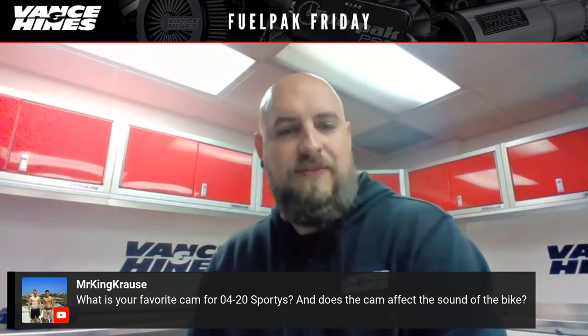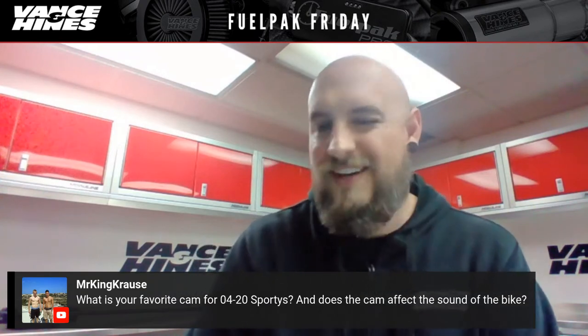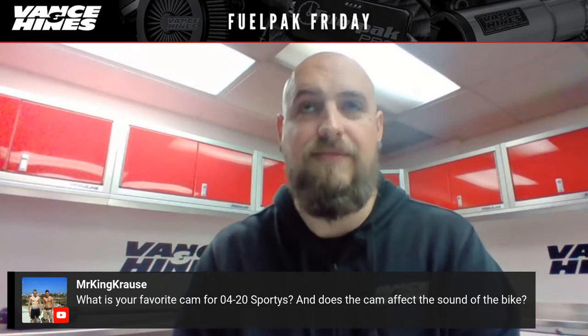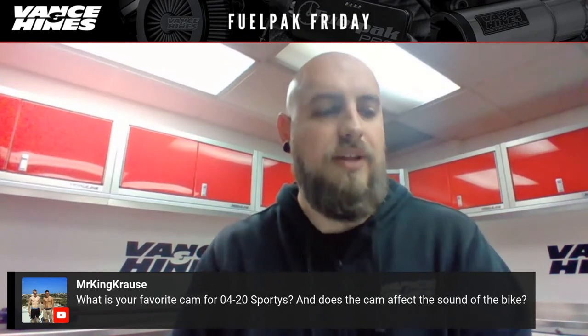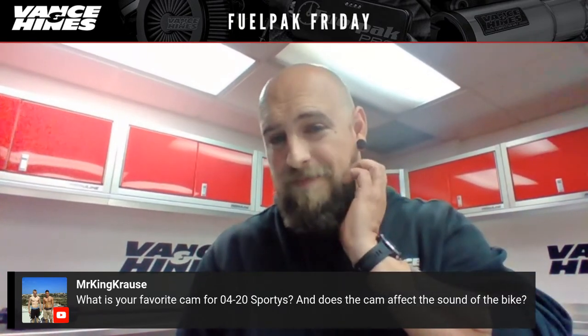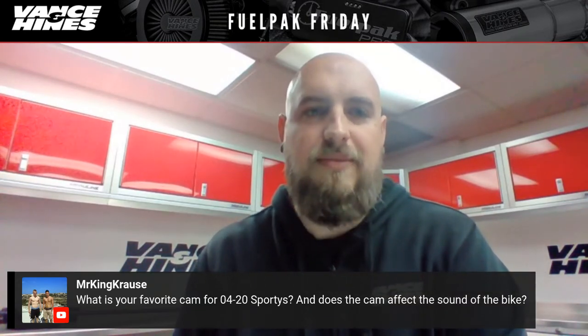Mr. King Kraus says, what's my favorite cam? 04 to 20 Sporties. Does the cam affect the sound of the bike? The cam will affect the sound of the bike a little bit. Just that increased lobe and duration does make a tiny bit of difference. It depends on the application. So if you're looking at just a stock bike, if you're seeing to throw them in at 1200, I like the Andrews N4. It's a pretty good cam.